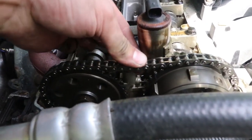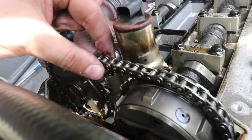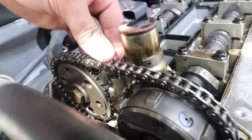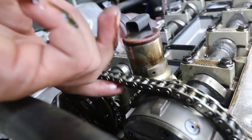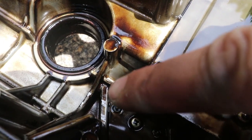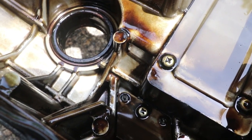You should not be able to do that. That VVT is bad. I don't think I'm going to be driving this car until I get this fixed. Holy shit guys, that's terrible. And then you can see on the valve cover, you can see here there's scratches — that's from the chain hitting the valve cover. So Phil, you were correct. It was hitting the valve cover and looks like I need a new VVT guys.